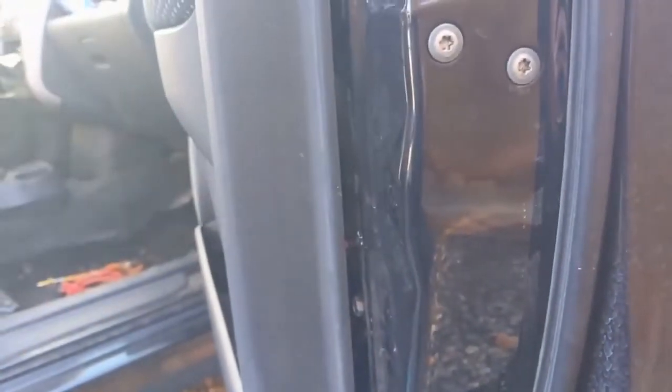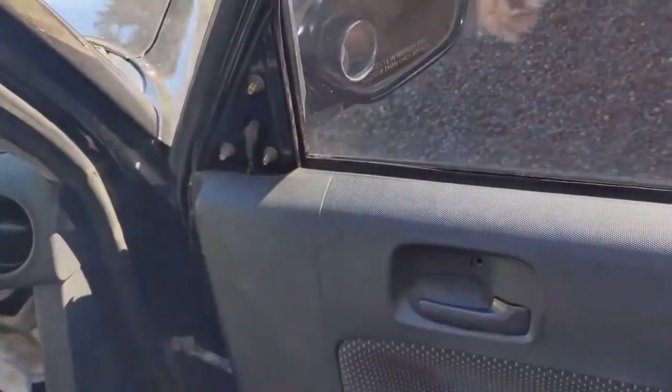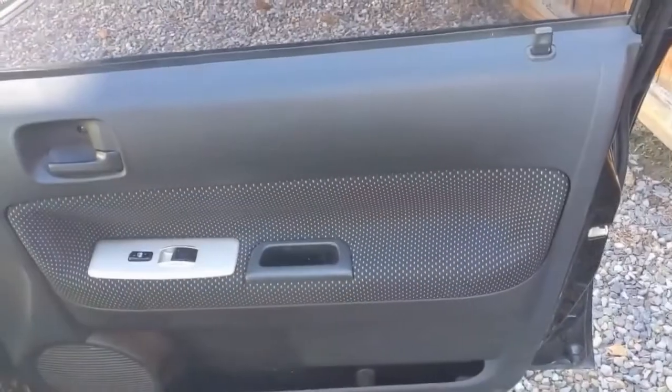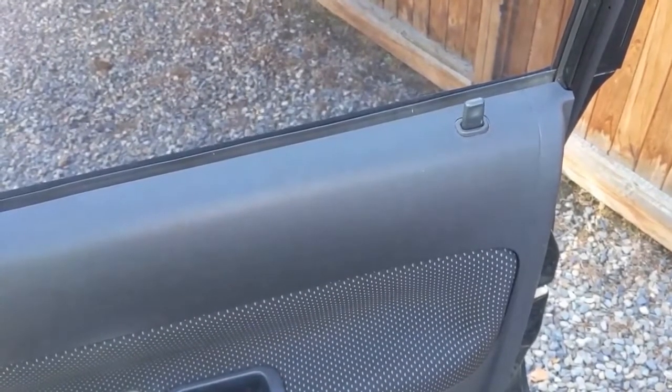Just line up the clips to their little respective holes and tap them all back in. Then set the little handle back in and put that screw in, that screw in, that screw clip in, and then the little wing piece. Panel's back on — lock, unlock. Confirmed fix. That's how you replace a door lock actuator in your Scion. They're pretty simple, just a couple of screws and they pop right out. Popping them back in is a different story — it's not too complicated, it just takes a little fidgeting and maneuvering, but it'll go back in. Thanks for watching — like, subscribe, see you on the next one.